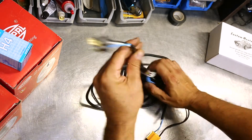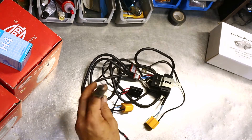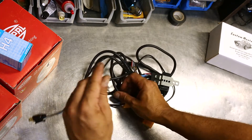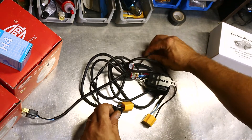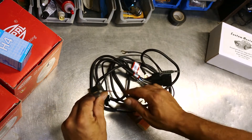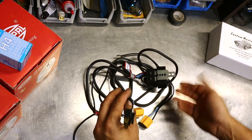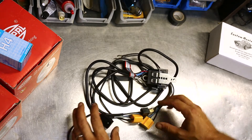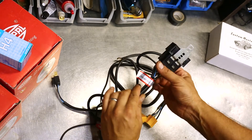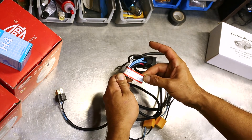The way this works: we have a little feed that goes into the existing wiring harness — that gives us our high beam versus low beam power signal so we can switch the relays. Then these take the power that comes through a separate higher-current feed, and we have a matching high-current ground. All the higher current goes through this section, so this is purely the signal wire to actuate the relays. That makes it very easy because you don't have to pull the existing harness out or cut and shut anything. Depending how pedantic I'm feeling on the day, I might do that, but there's really no reason to — all this stuff you can tuck away and make it fit somewhere nicely. It looks like it's been through quality control, and the circuit already has fuse protection.